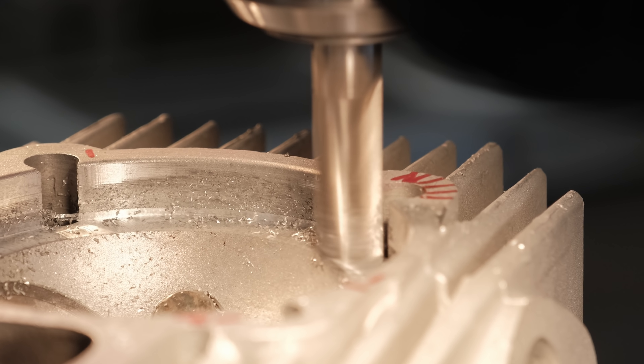So this is where I was ramping the head up, ramping the tool down. I lowered the table there to end the cut. Basically there's not much left between the valve seat - I haven't hit the valve seat because I didn't want to, as that's hard material. I'm down as far as I can go, so I took about 55 thou. Now we have to change the cutter and mill all this here down to the right height.